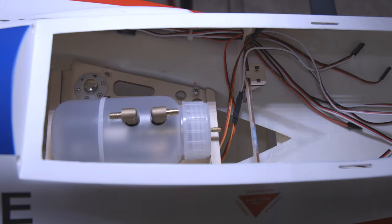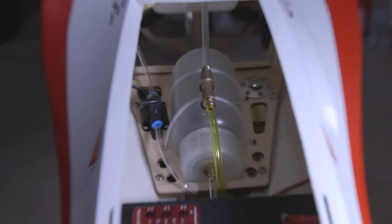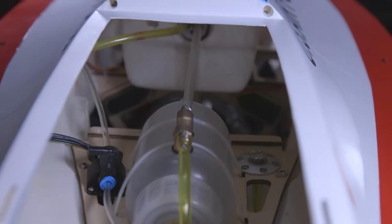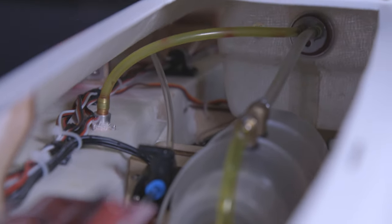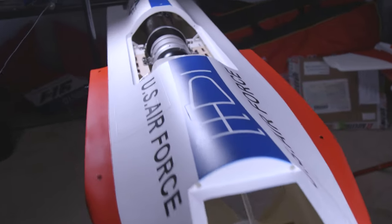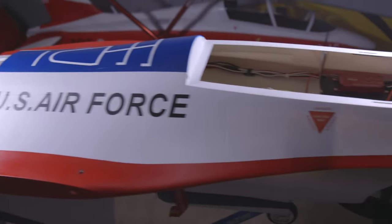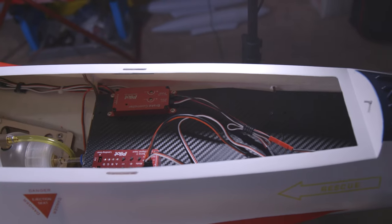We are officially done with the fuel plumbing on the F-16. You can see the UAT with the fuel pump directly below it, the ball valve on/off to its left, the main fuel line leading to the fuel tank, the vent line, and the fuel filter. To the back of the aircraft, the ASX-80 is installed and plumbed up. Fuel plumbing is complete — we'll get started on the electrical in the next video.